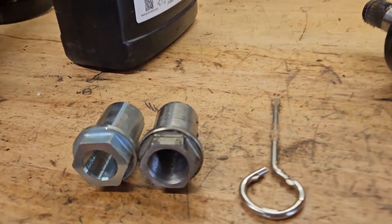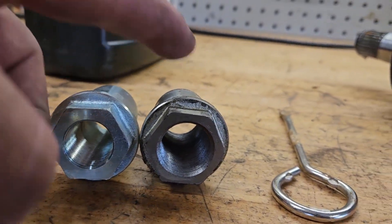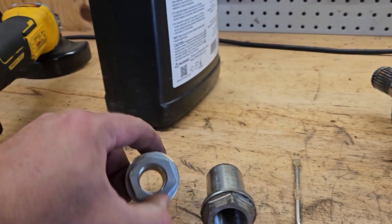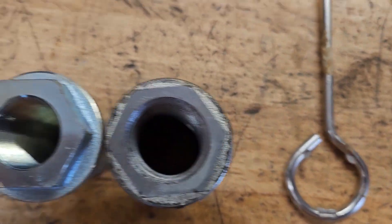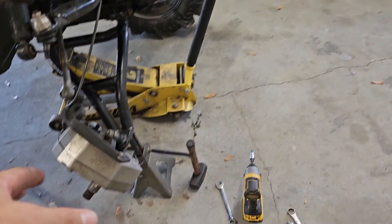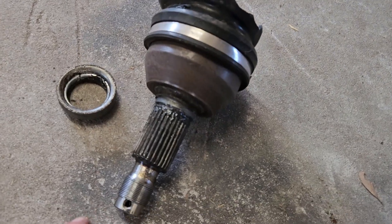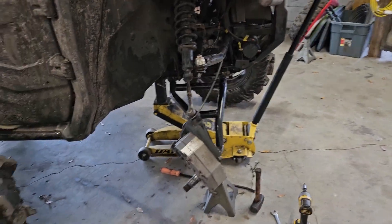Here's a good illustration of the differences between a 2021 Pioneer 1000 axle and a 2022 — the hole is a lot bigger on the '22. So I'm going to have to use my old axle nuts that came with the portals, not my custom ones. Yeah, they made the threads fatter there, but the splines are the same. Not really sure why Honda changed that, but they did.